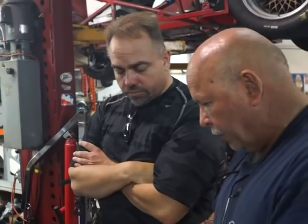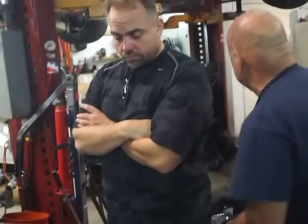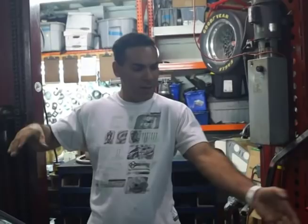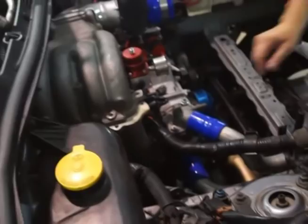The mounting of the air conditioner, which is just a little piece, a little bracket. Part of it goes to the RX-7 engine, that's why. Fabricated an exhaust manifold, turbocharger, intercooler, radiator kit. It's hard to see, but when you look at that box, mm-hmm, where you see the wood section, mm-hmm, that's the air that comes just for the intercooler. You have the exhaust manifold on the engine? It's on it. All right, so you can see here. Yeah, I see the turbo manifold. Yeah, that manifold there, I custom built, made a jig for it, so they're all the same.